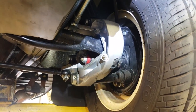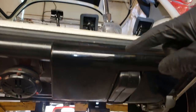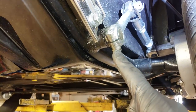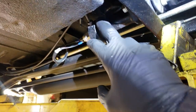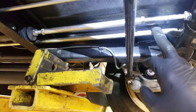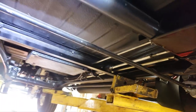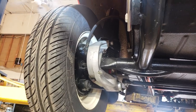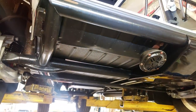It's a very compact and ingenious little contraption. The steering box comes directly out of the car into basically a worm drive, then goes to a little shaft which turns a wheel connected by a drag link — super simple. This is our pedal box area: we have our clutch, brake, and gas. The master cylinder is located right next to the battery underneath the seat, connected via a long rod from the pedal, as well as a clutch rod and gas pedal. This car is equipped with radial tires — most originals only had bias-ply. It does have hydraulic brakes with a master cylinder there.